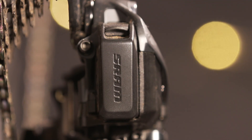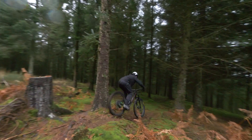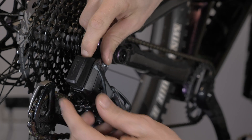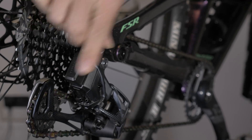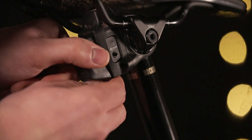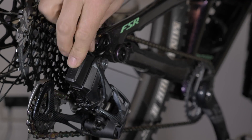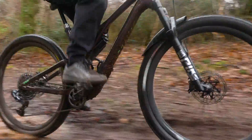The battery unit itself is mounted on the back of the derailleur — it's out of harm's way there. The battery lasts for 20 hours, takes one hour to charge, and it's compatible with all the other batteries within the AXS ecosystem. You can hot swap these batteries too, so there's no need to re-pair anything — you can literally take the battery off and plug another one straight on. If it runs out on the trail, the derailleur will stay in the last used gear. You can swap in a battery from your Reverb and continue riding, and of course it's completely waterproof.